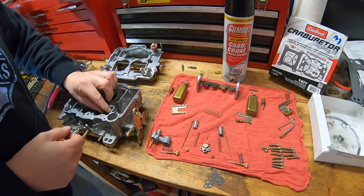Let's snug that second needle valve down — good to go. You can see on the live stream that the fuel inlet is on the passenger side and you can see that little screen sticking up in there. Again, this is just another last little defense to keep the garbage out of there. Definitely use those screens — don't leave them off.